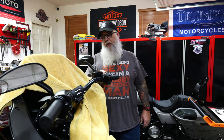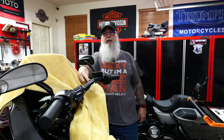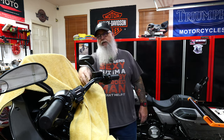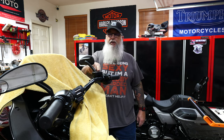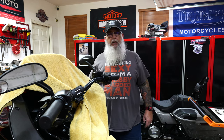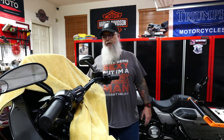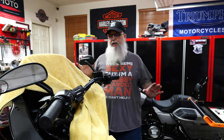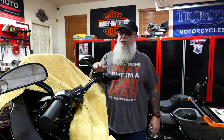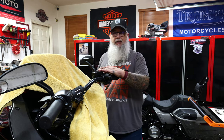Now we're ready to start over on the right side. We've got the master cylinder, brake lever, and all that stuff. You have to drain the master cylinder because we're going to be disconnecting this brake line to put a longer one on. First thing is to drain that out, then drain the brake line from the front calipers to minimize as much mess as you can. I've put towels all over the place — over the fender, the front of the fairing — because DOT 4 is very corrosive. I'm going to work on taking off this top cover and draining it out.